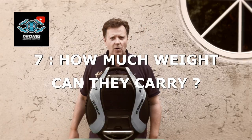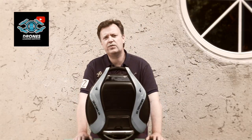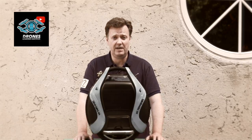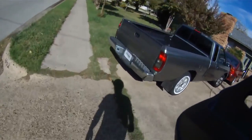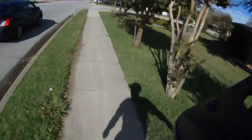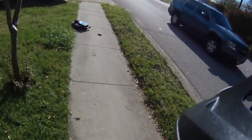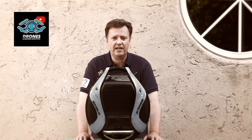Question number seven: how much weight can they carry? Most electric unicycles are specified to 200 pounds, but in reality they should not be pushed to that limit. When you push the wheel too hard, the motor cannot deliver enough power to keep the wheel in balance and the motor will likely cut out. We recommend never going with less than 800 watts of motor power and a battery pack of 680 watt-hours.